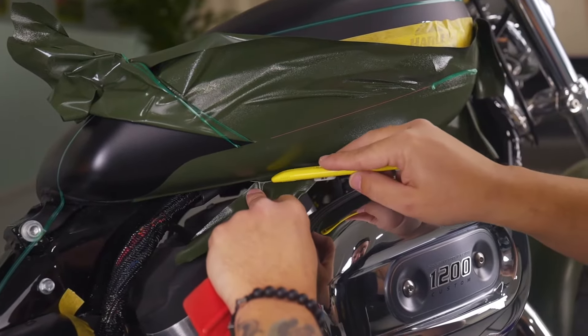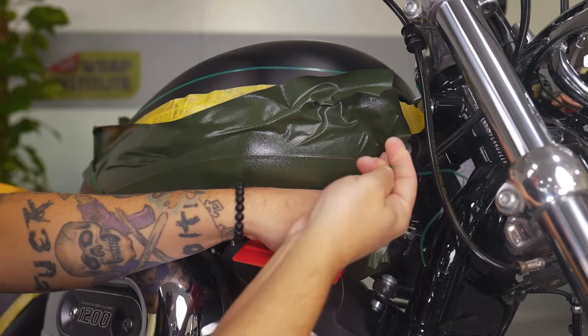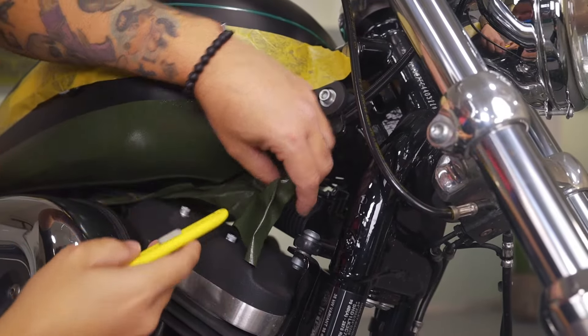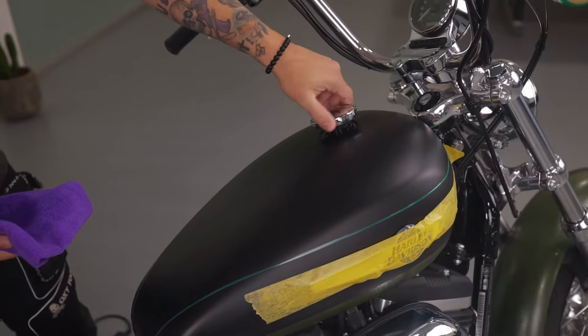On the top section, knifeless tape is used because it's a direct cut on the body; on the underside, a knife can cut the film away. Release the excess film. At the front, simply tuck the film into the open edge and cut the excess film away, since that's not a direct cut on the body.